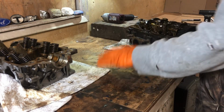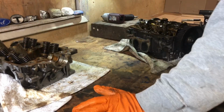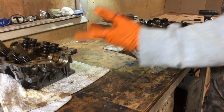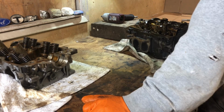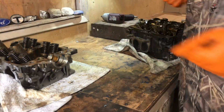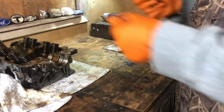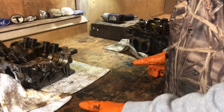Once everything's satisfactorily clean of grease and oil and grit, then I'll do the valves one head at a time. When the valves are out and the oil seals are out, I'll resurface. We'll make sure everything's resurfaced properly. Might even send the shells out to the machine shop, but we could do that ourselves. I did that on the heads. You get a piece of glass and you go from like 600-800, don't quote me, all the way up to a super fine grit of sandpaper. If you have some stuff to take care of, you can go rough, but then you slowly bring it up to a nice smooth finish.